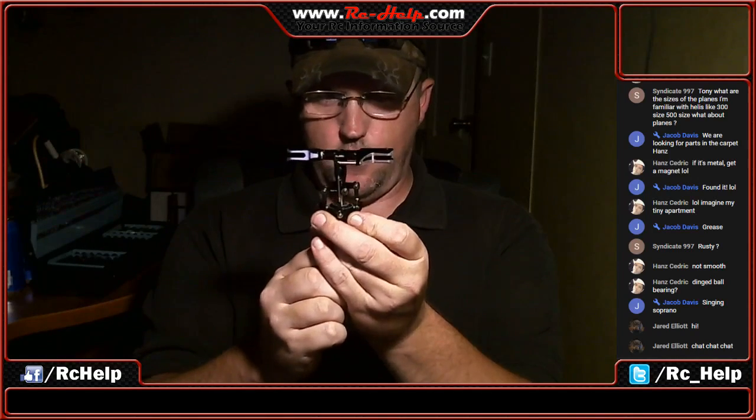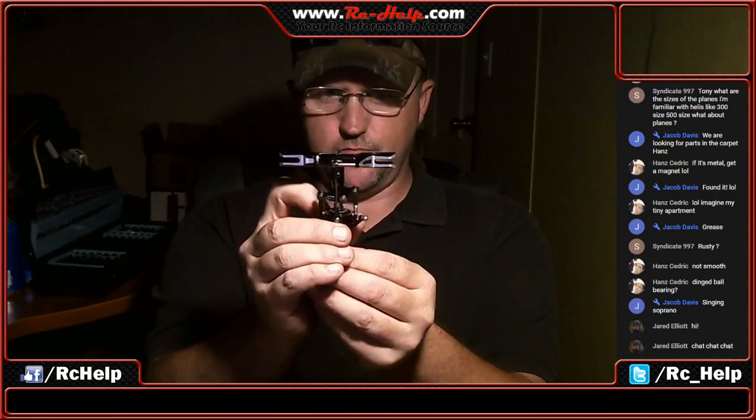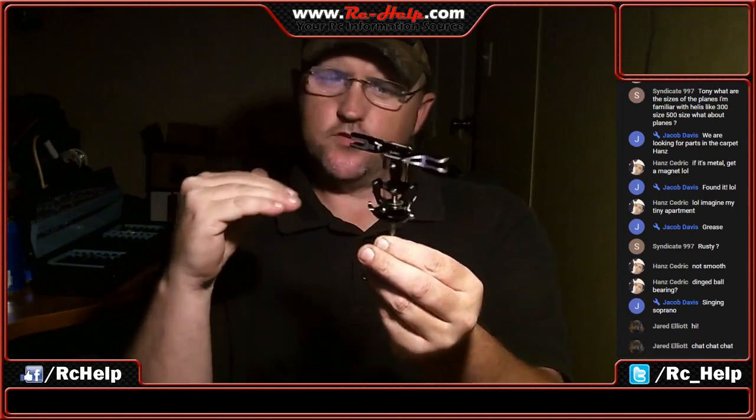So right there, the swash drivers are straight across, and we're showing a little bit of negative pitch. Right there, we have zero degrees of pitch, and the swash drivers are just a little bit high. I mean, we could take that out. No problem.